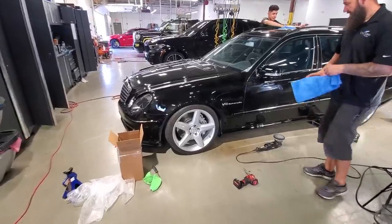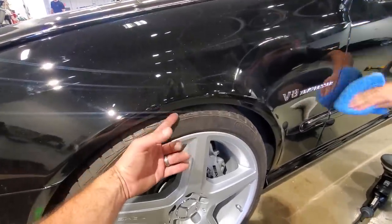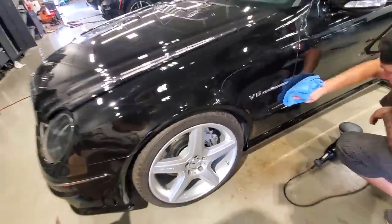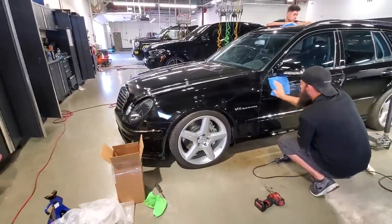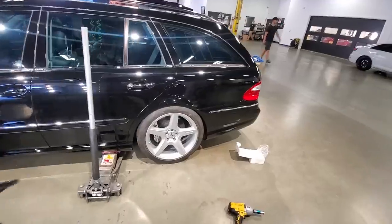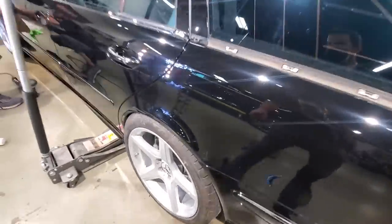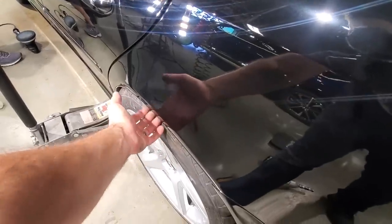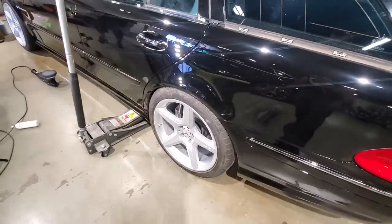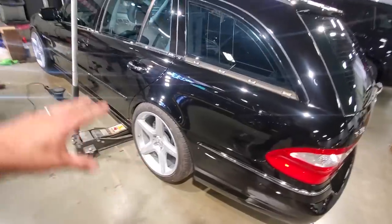This is looking good in the front. The wheel spacer brings it out just enough — there's a little bit of space, we're not going to damage the fender, and I just love the look. The rear is kind of a different story. I put the 10mm spacer back there and I don't think it's going to work — it's almost touching the quarter panel and we haven't even fully settled the suspension.